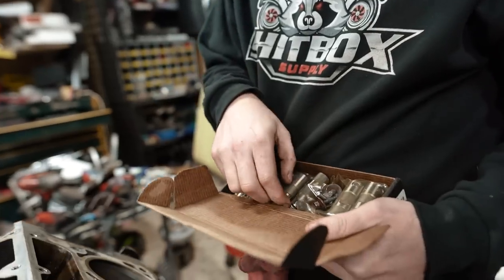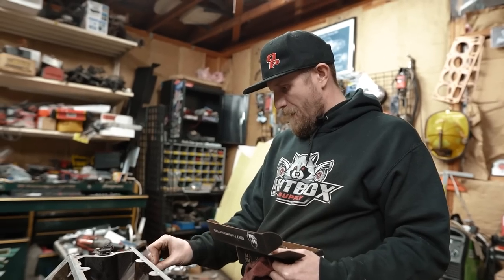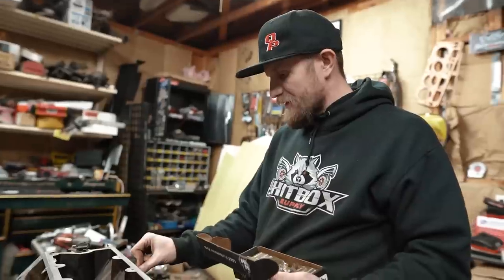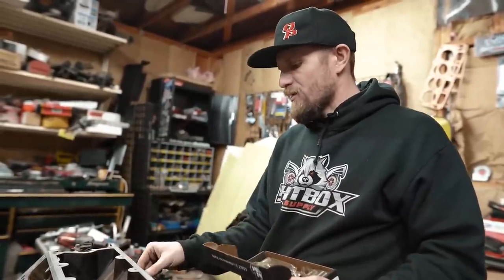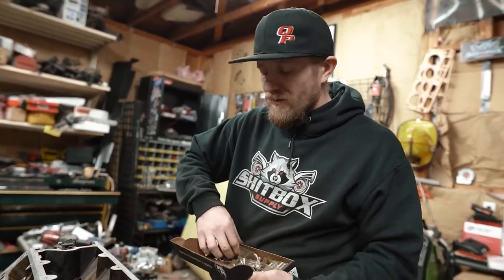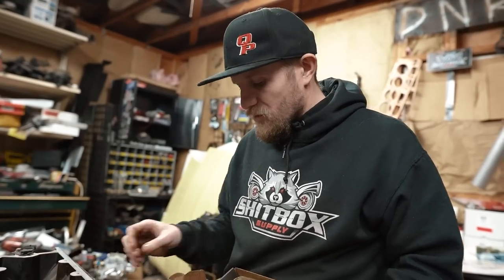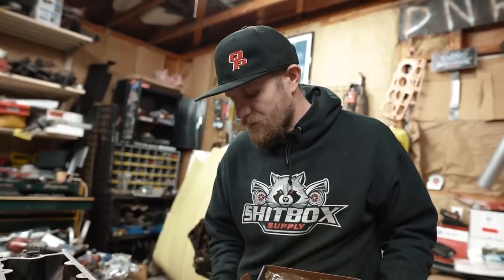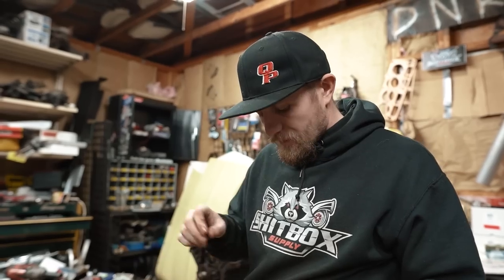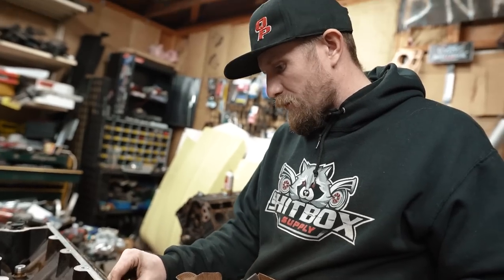Brand new. Hopefully they go right in. There we go, a little slide action in there. Perfect. Like a glove. They already got a little lube on them. Lube is going to be important in this, because as I've been putting this engine together and turning it over, don't get me wrong, it turns over very smooth, it's beautiful, it's nice. But it's a little tighter than what I normally feel when I'm doing these junkyard LSs, but it's also got brand new bearings. So I'm going to have to set up this little oiling system trick where you use the pressure sprayer and then you go on the side of the block and everything. We're going to have to figure that out and set that up before we put this motor in anything, because we want to have good oil pressure. We don't want to ruin these bearings we just put in. Oh yeah, but these things like a glove, baby. Brand new set of lifters never hurt anyone.